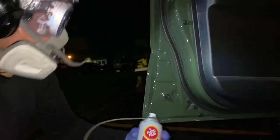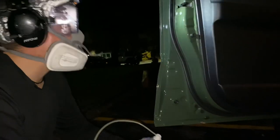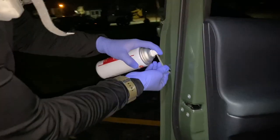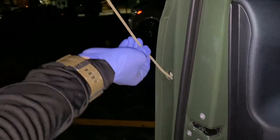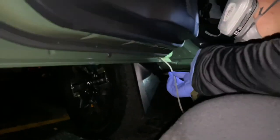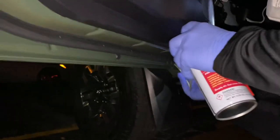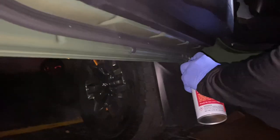Another thing that I learned was with the fluid film — weather stripping you want to avoid, because it could swell a little bit, which is going to make it sag. So I'm going to do my best to avoid that area. What I want to do is go in one direction as far as I can go, hold it down, and slowly pull it out.